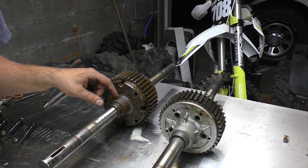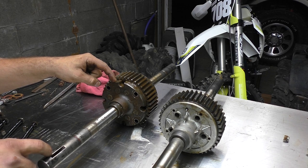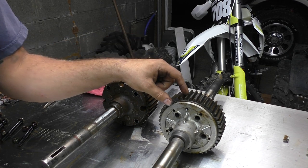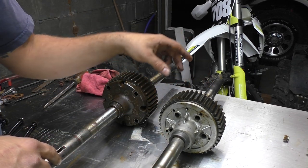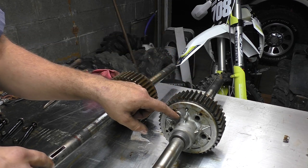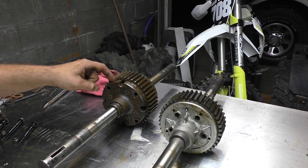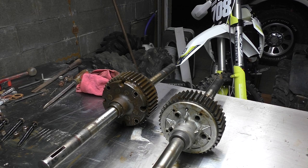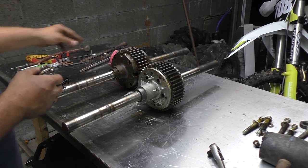The axle on the left is out of the uni-drive with the double-D brake shaft — these are inch-and-an-eighth axles with a cast iron carrier. The other axle also has inch-and-an-eighth axles but has an aluminum carrier. This one had five 3/8" bolts with nylon lock nuts holding it together, and the other had four 3/8" bolts with regular lock nuts. Let's pull them apart and see the difference — we'll do the cast iron one first.